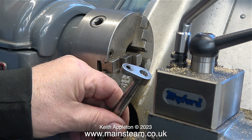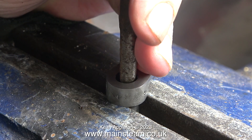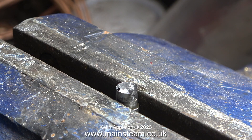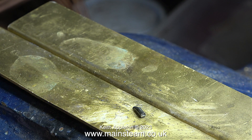Now it looks a bit of a mess — the hole isn't very neat at all, but it really doesn't matter. With the part lightly clamped in my vice, I'm knocking out the old crankshaft using a centre punch. You can see how little metal was left of the crankshaft, so it was very easy to tap it out of the crank web. And this is what I poked out of the hole: it's just a piece of steel. I'm really pleased about this, because had it been a piece of broken drill bit, I would have had to use an entirely different technique.